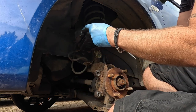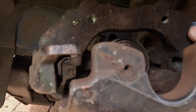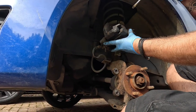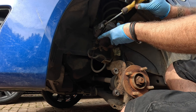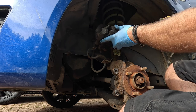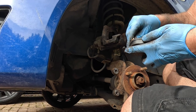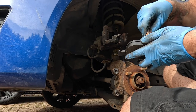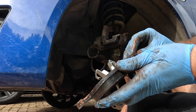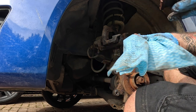You've got channels where the brake pads sit - you can see they get all gunked up, as you can see inside there. I'm going to wire brush inside it, and I'm also going to run these runners a bit. Just use a screwdriver to get any crap off the runners - we want the pads to sit well. Now we need to put a bit of copper grease on the back and a little bit around the sliders as well - just over the back of the pad to stop it making any noise. Have a cloth nearby to wipe your hands so you don't get any copper grease on your pad.